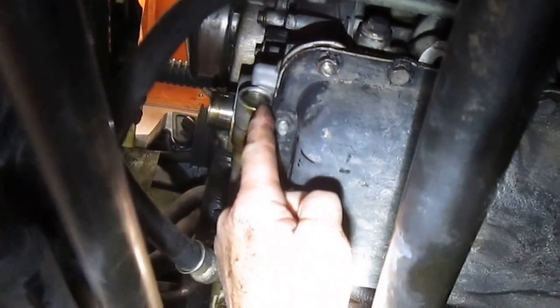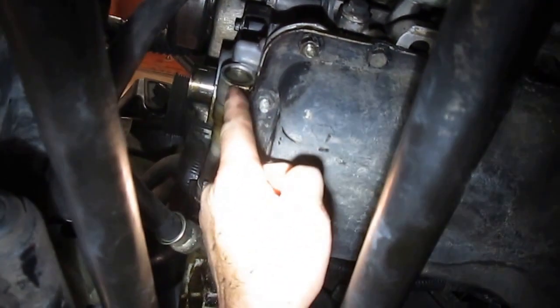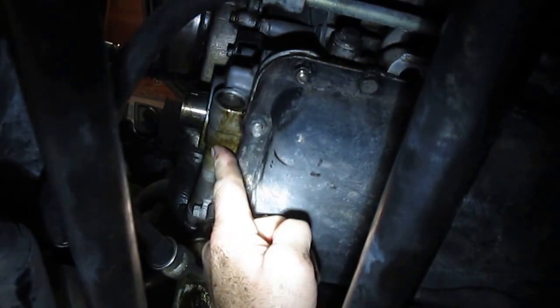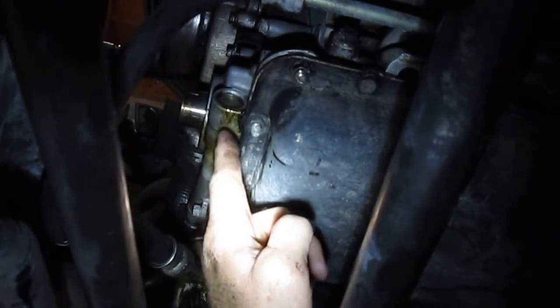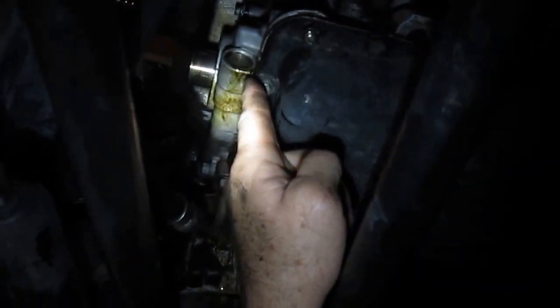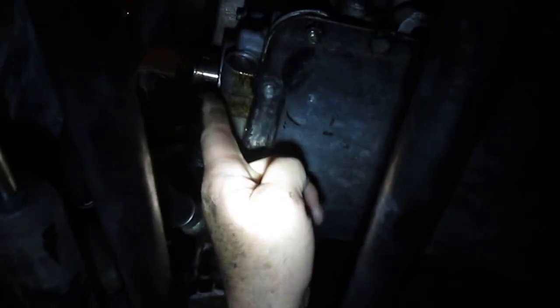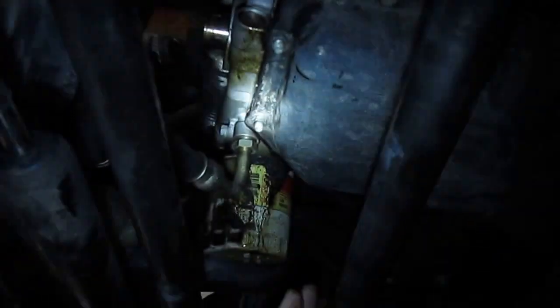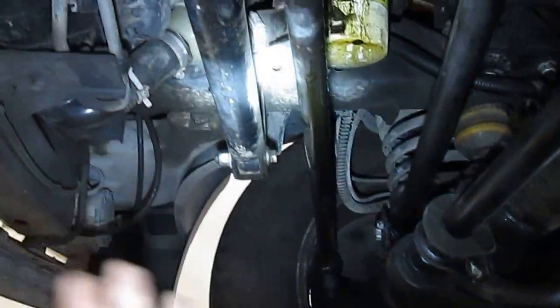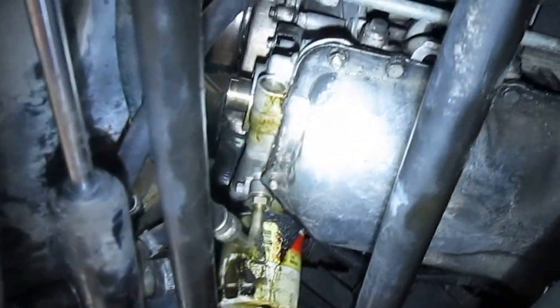On the outside right here there's a little bit of oil leaking. There's a plunger with a spring for the oil pump inside — an oil pressure relief. There's a 19 millimeter by 1.5 millimeter o-ring behind there that we haven't been able to locate yet because it has two leaks there. We cleaned up this whole front area, which was just full of oil before.